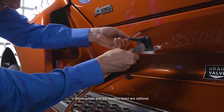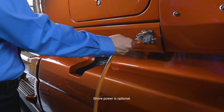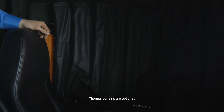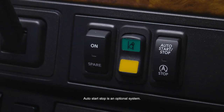Let's discuss stationary operation of your vehicle. An optional shore power connector under the driver's door is used to provide electricity to the optional oil pan heater, optional block heater, and optional heated fuel water separator while the vehicle is parked and the engine is off. Unplug the cable just before starting the engine. An optional shore power connector under the sleeper is used to provide electricity to the sleeper compartment power outlets while the vehicle is parked. Unplug the cord before moving the vehicle. When sleeping in the sleeper during hot or cold conditions, close the optional thermal curtains on the windshield and in the sleeper, and place thermal curtains on the windows. These help maintain a comfortable sleeper temperature and reduce fuel consumption. The optional auto start-stop system monitors battery voltage, engine coolant temperature, and engine oil temperature. When any of these are low, the engine will automatically restart. The engine will run above low idle RPM to charge the batteries and warm the engine, then shut off automatically.